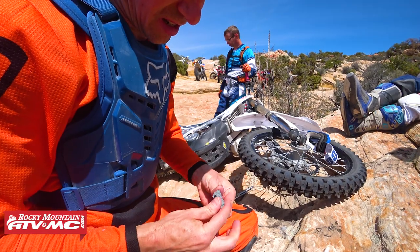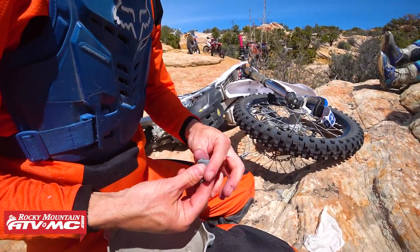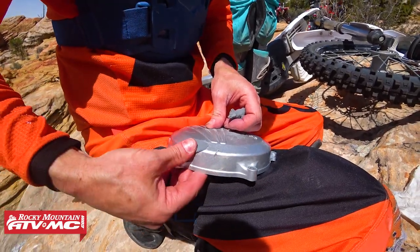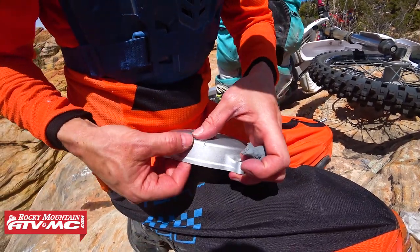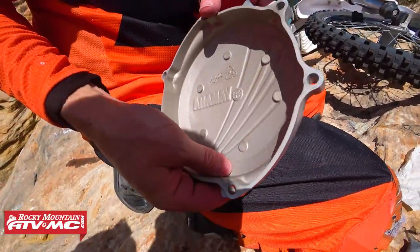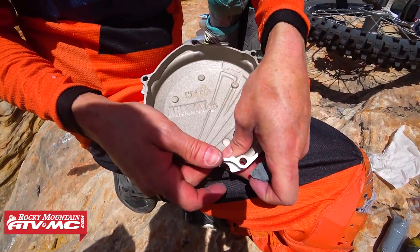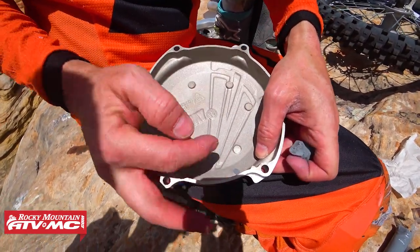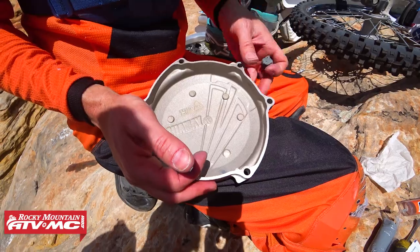You just want it to be a consistent color once the black and the gray mix together. I'd say that looks consistent enough. So I'm just going to press it on the outside — it almost feels like bubble gum — and I'm going to try to get some in the hole that the brake pedal made. I'll pack some on the inside too, but I'm not going to go too far inside because the clutch is pretty close and we don't want any more material in the oil and transmission than we can help.